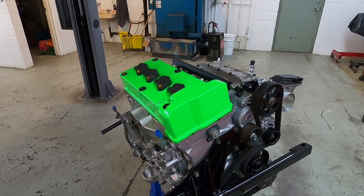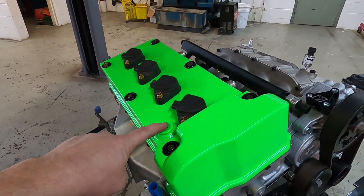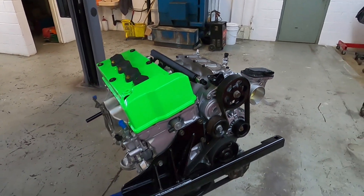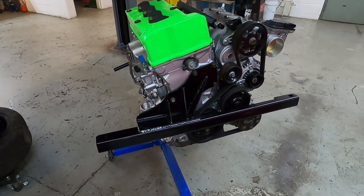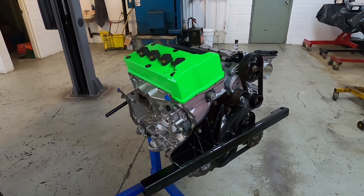It's pretty close to what it was supposed to be. Before we sent it off for powder coating, we welded in a bung that allows us to fill the engine with oil, and two bungs that allow us to do all the plumbing for the catch can setup. We also sent out the engine brace for powder coating and it looks fantastic.